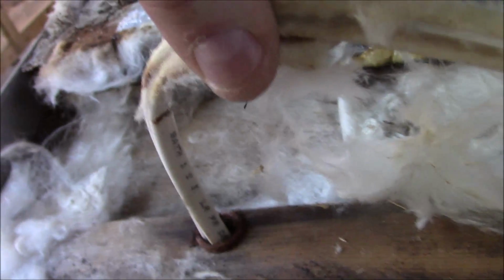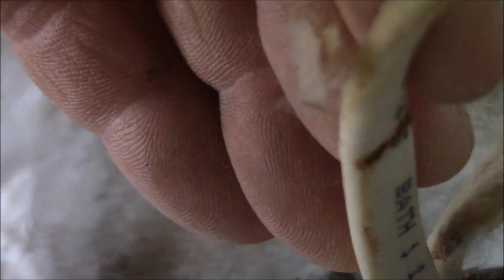So this is one of their aluminum frames. And even though, I mean, this thing still seems like it's got some wetness to it. So one of the other things we want to do is peel back this insulation. Then I want to look at this. See that there? That's a metal ferrule. And this wire has been leaning that way. So let's see how good or bad that is. Look at the score that's doing. It's working its way in. That's terrible. And I tell folks, these RV manufacturers won't spend one more penny than they have to. And I'll show you the fix, but that is a pretty good score in there. See if I can zoom up yet a little bit more. You know, that could work its way.